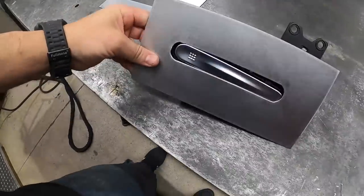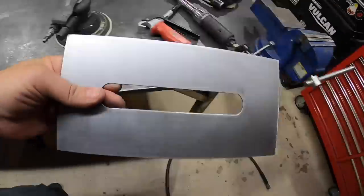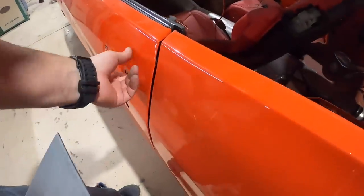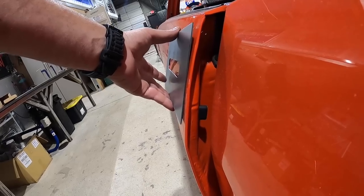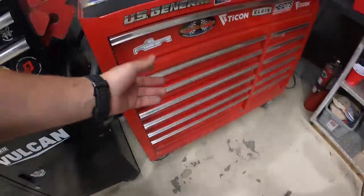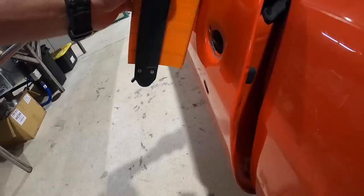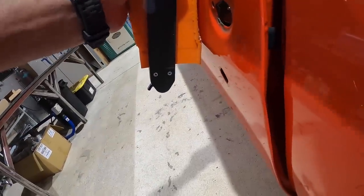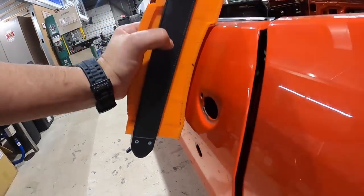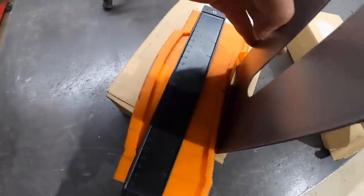Pretty happy with the way it looks — it's in there nice, just needs a little more love. The door is going to be contoured, not flat, so we're going to go ahead and open the door up — there's a good amount of bend we're going to put into it. We'll take it over to the slip roller, and we'll use our contour gauge. We push it into the door just like so, and now we have a perfect contour to work with — this acts as our gauge when we go over to the slip roller so we know exactly how much to bend it.